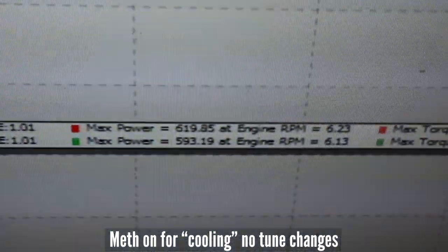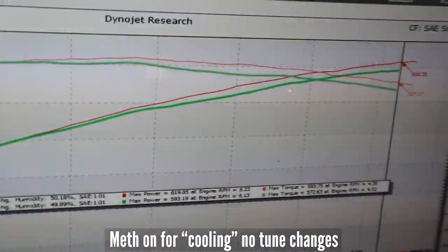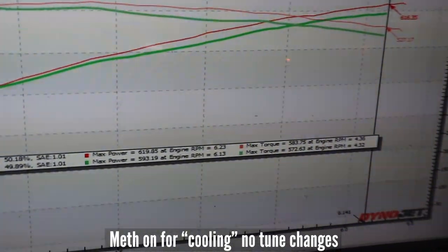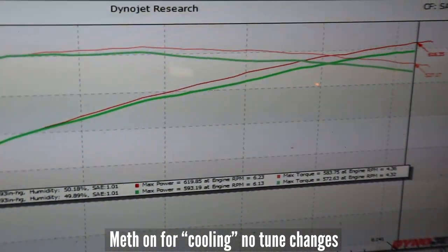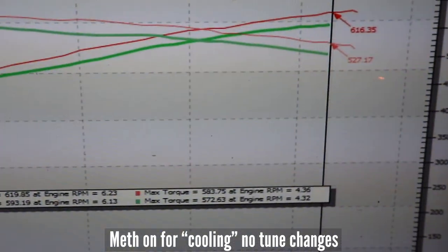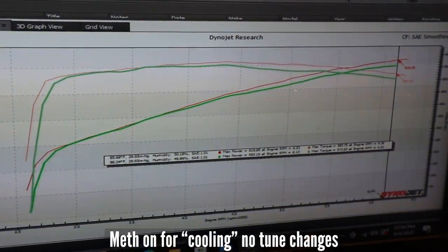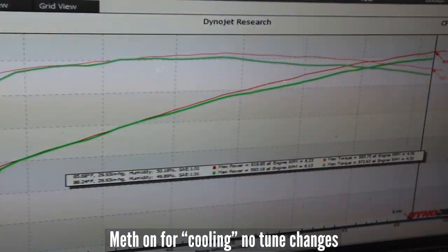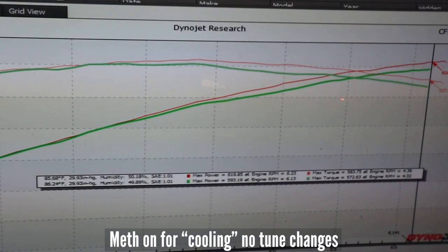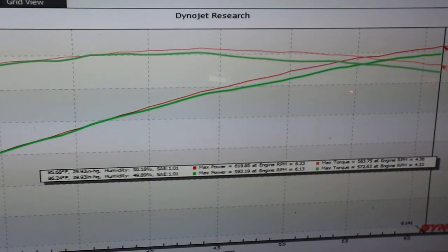Like I said, it's going to add fuel and it's going to burn slower. I'll show you the log too. That's a dual nozzle — single 15 and single 10 on M1. And being a positive displacement blower car, the meth doesn't do anything for cooling anyway because it evaporates before the blower. If you spray it after the blower, you'll get cooling effects. But you could also pour chocolate milk on your intake sensor and that would also cool — doesn't mean you're going to make more power.